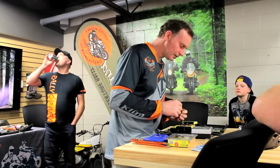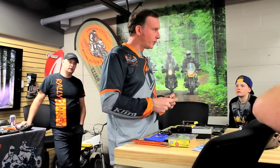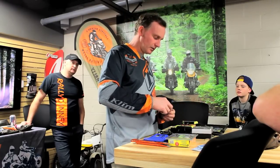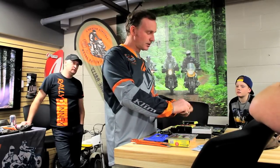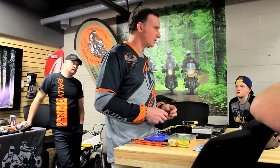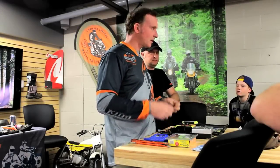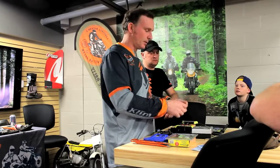Inside of here, there's either a needle, or in this case, it's just a sharp wedge that comes down. You wind it down, you break the foil, and then you put this on the tire, locked, and you open. So the cartridge now sprays into the tire, right? Generally, it's a one-shot deal. The more you wind this in there, the more you break the foil. There is a point where you reach the end of the stroke and that's it, and you've got a leak path around it. So sometimes you can get a seal for later. Don't count on it. Do it with purpose. Have it ready, stage yourself properly, have it on the wheel, then break the seal and go. Otherwise you might waste it.